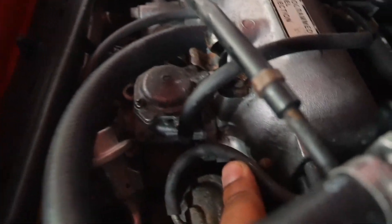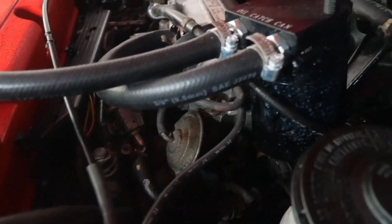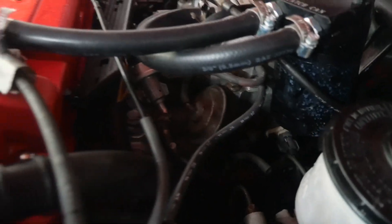I'm pretty sure the IAB plates have been open this entire time. What I did — since the solenoid isn't working — based on research, people have been hooking it up to a vacuum line off the intake manifold. I have it hooked up right here and keep the plates closed until full throttle or high RPM, then they open. It's not the best thing but it's better than nothing, since this entire time they weren't working at all.